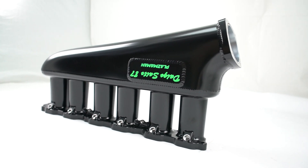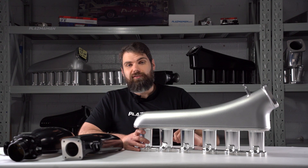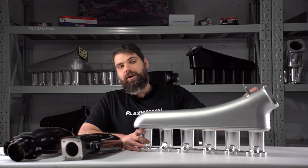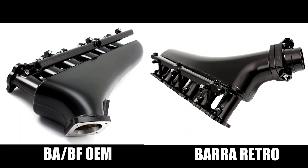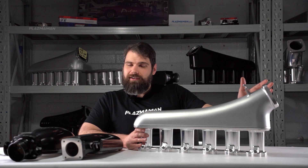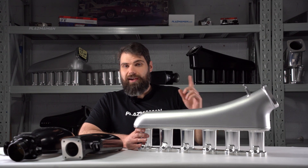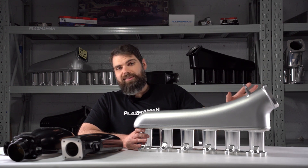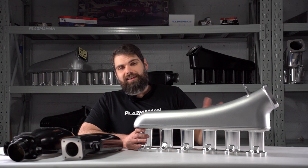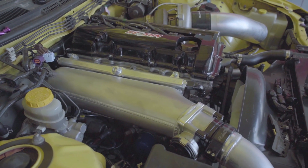This particular intake we have here is one of our Barra retro models, designed for conversions of the Barra engine into older Falcons and a lot of other older cars. The plenum design was dictated by the need for clearance, because fitting that large Barra engine in some of the older Falcons puts it quite close to some of the strut towers. So over the standard BA, BF, FG Falcon Barra intake manifold, we had to reduce the dome shape to allow it to fit in those older cars. This is about as small as you'd want to go on the dome for a Barra intake — any smaller does start to choke the engine. Shape of a plenum can be really important as well, as it will help guide the air to all cylinders.